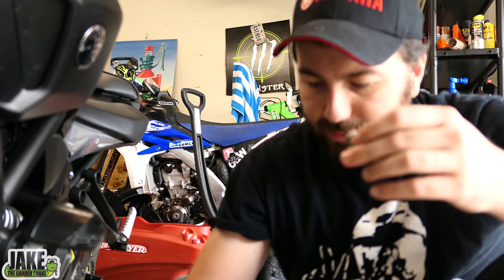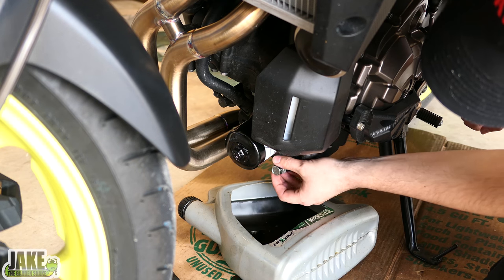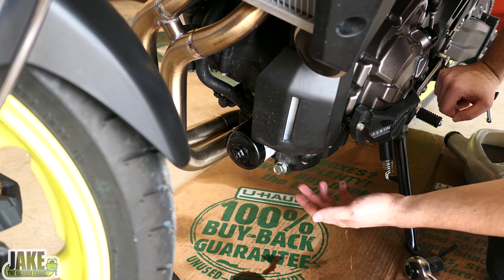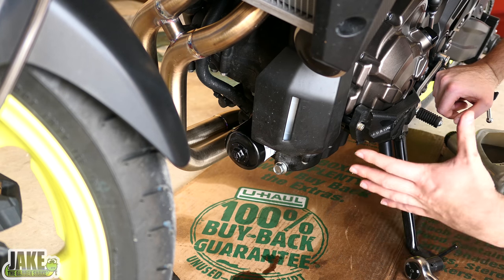Okay, drain bolt. So many people don't like replacing these crush washers — they just think the one on there is fine. Just go get a pack of them. I bought this entire pack for just a few bucks off Amazon. Don't skip the crush washer — the next time you'll be tempted to say forget it, but just use a new one. If you're confused about what crush washers do: they're a soft metal, and when you tighten them, they smash and create a perfect seal against the two surfaces.